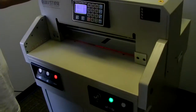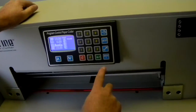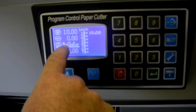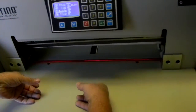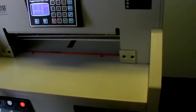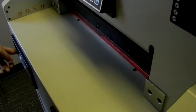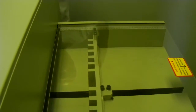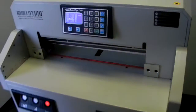There's another function in manual mode. If you don't want to stick your hand underneath the blade to get your paper after it's cut, you can hit this button, which puts a little arrow on screen. That tells you that between each cut it's going to push the paper three inches forward so you can grab it without sticking your hand underneath. Then it travels back to the 10 inch mark automatically. So if you're constantly doing 10 inch cuts over and over, after the cut the paper moves forward three inches and then goes back to the 10 inch mark.